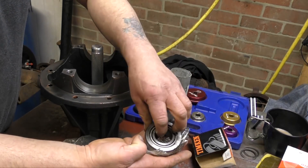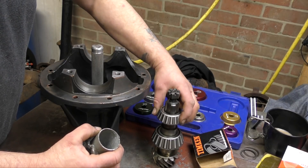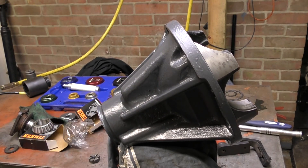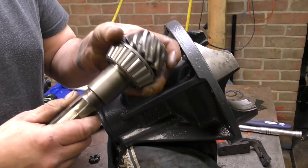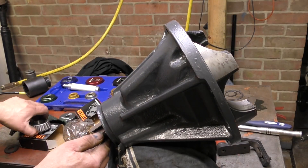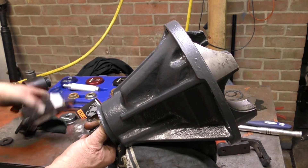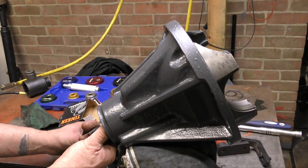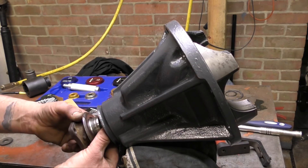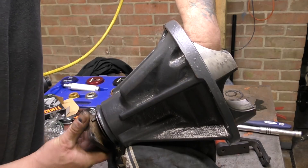The other bearing — I've put the race in the case already. This one is quite a loose fit, so no press is needed on that. The next thing to do is go ahead and fit the pinion. Now that you've got your bearing cups or bearing races in the final drive casing, we can go ahead and put the bearings in and then just nip them up. At this moment I'm not going to lubricate it because we're not rotating it to any great extent. I'll put the bearing in, and with these flanges you have a spacer — I'll fit that and then just bolt it up.